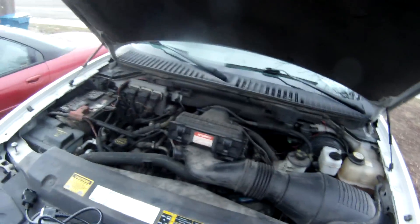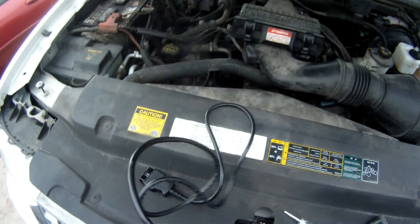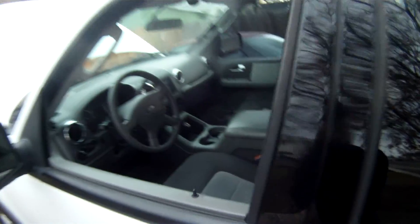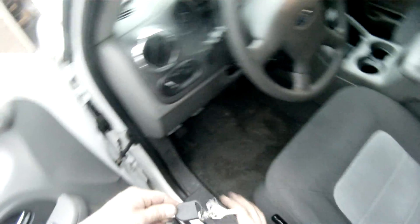It's got the coil-on-plugs and they're going to be 100,000 mile plugs. I thought I had a video on why this engine is a horrible design when it comes to the spark plugs and everything else, but I guess I don't. So the first thing we want to do — we were told there's a check engine light on — but before I check that, I'm going to start this engine. With the way the hydraulic lifters work on this engine, if you've got a dead cylinder you can definitely hear it; the lifters will shut down and you'll hear them clacking.